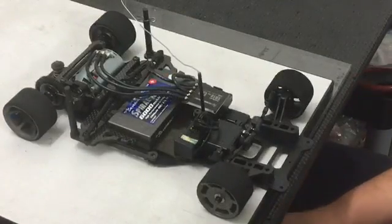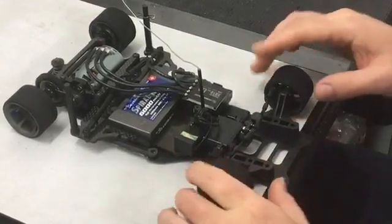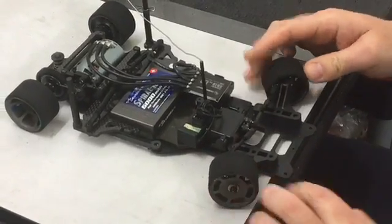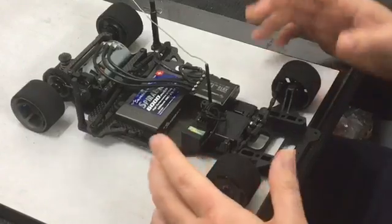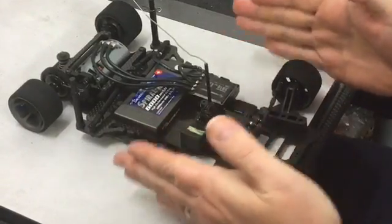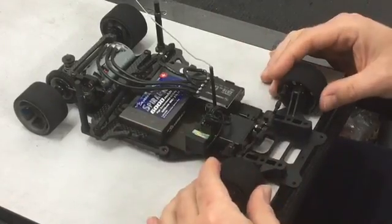One last thing I like to check on my cars before I go race is obviously front spring droop. Now obviously springs wear, they start to sag after time. If you have a big impact they can sag as well, so making sure you have equal spring sag left and right also can affect the tweak, or the way the car drives left and right.